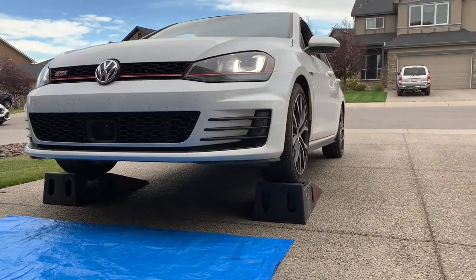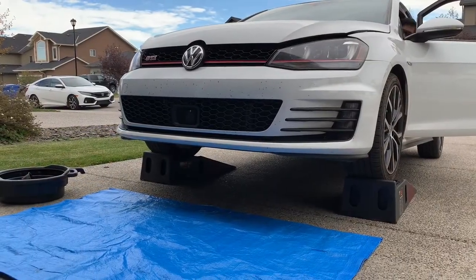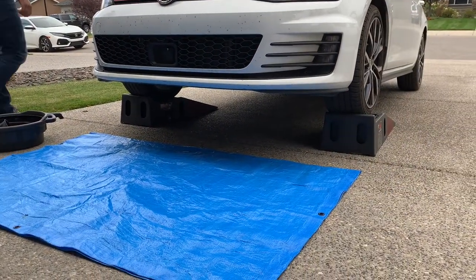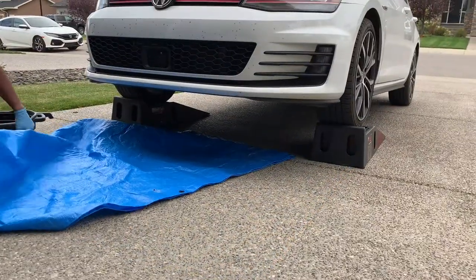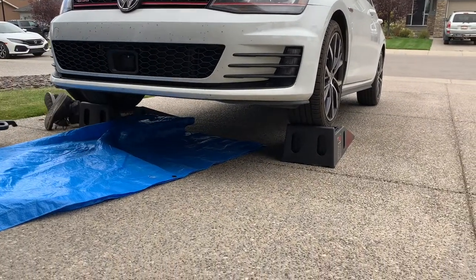To start, you want your car on ramps or safety jacks and then set your hand brake. Pop open the hood and slide a pair of wheel chocks behind those back tires. I always recommend sliding a tarp under the vehicle to catch any debris or accidental spills.